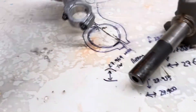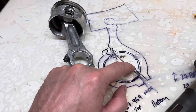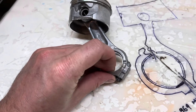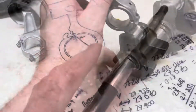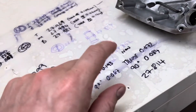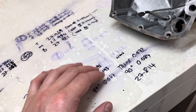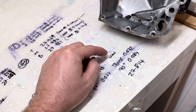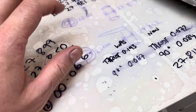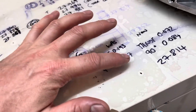This is the connecting rod where the cap comes off. I was working on the cap at this angle — you can see it's no longer square, it's actually tapered. The same at the top. I found it was just a bit tight so I put some valve lapping compound on and lapped it gently, then torqued it up to spec. I was looking for around 0.05 to 0.075 mm of clearance. Originally when it first came apart, the thrust clearance was 0.193 mm — it was huge, no wonder we had the knock. At 90 degrees to thrust it was 0.087 mm, slightly out of spec but would have been fine.